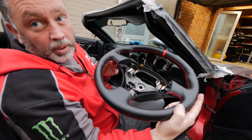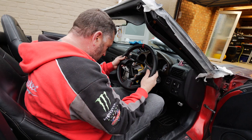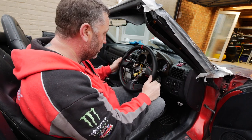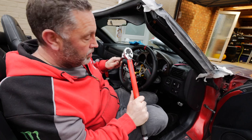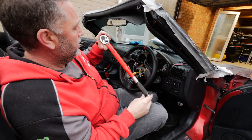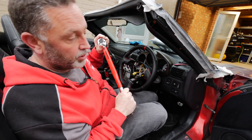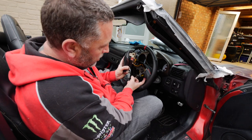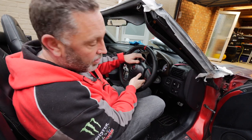There we are - that's the wheel we're putting on, the nice one with the red stitching. Nicely recovered. Hopefully that's centralised - if not I'll have to whip it off again and spin it around a notch, but it should be all right. According to Google it's 34 newton metres, but this wrench only goes down to 40, so I've done it at 40 newton metres just because I'm too lazy to get a smaller one. For the airbag, you just plug that in and push it back - it's got two bolts that go in there, I need to find those bolts later.